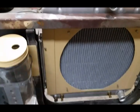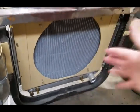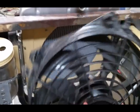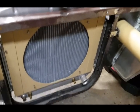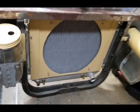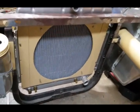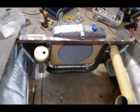It's set up for an electric fan — this is a 2400 CFM or so. I had this same setup on a 56 Bel Air and it worked just fine. Actually the radiator I have has one extra row of cooling in there, so that's even better. I have a sensor that bolts in the intake to make the fan come on and off automatically, so I don't need a switch. I basically had to mock all this up just to do the tubing to hide the wires and mount the horns.